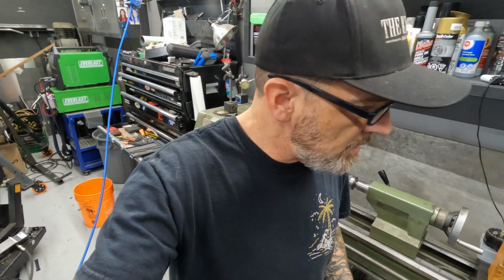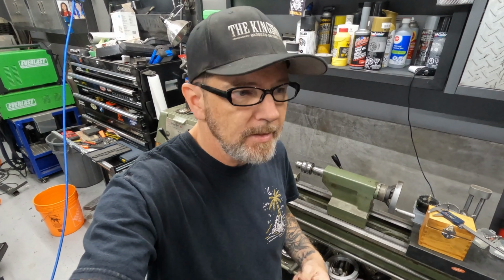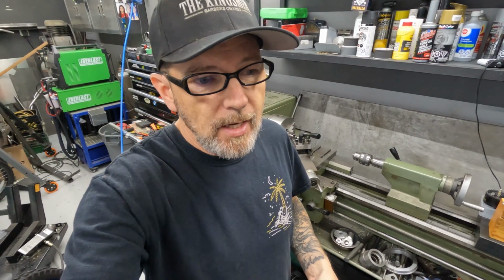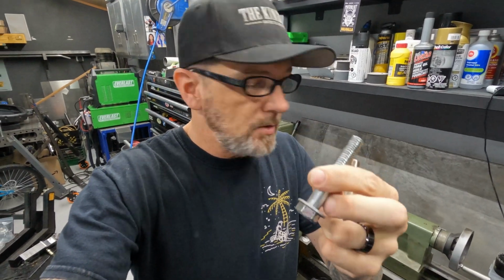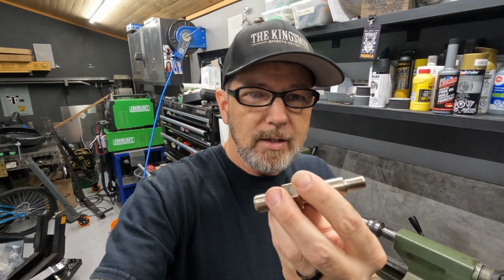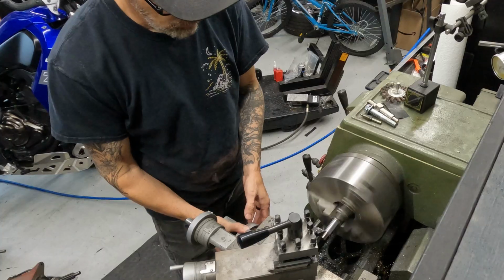I just thought I'd switch gears here a bit. I'm working on the Quick Performance rear end and my shock mounts. And I'm not running coilovers, I'm running Viking adjustable shocks, but regular coil springs. So I need to make a mount for the Quick Performance to actually mount up these shocks. And so previously I used these bolts, and now I found on Summit some RideTech kind of cool shock standoffs. The thing is, they're a little large in diameter, so I'm going to turn them down on my lathe here, and then just get them to fit into the shock bottoms.